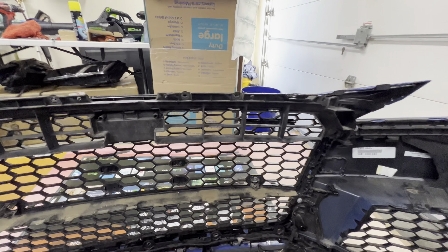The first things I removed were the lower tabs along the bumper. Then I modified the upper piece — you essentially just cut it off, leaving that section. I use the oscillating tool, which makes this very easy. Here's the back of the bumper completed. To recap: cut the bottom half of the top of the grill off, pull the lower part of the grill completely out, trim this section, trim that section. You also have to trim off that tab right there and that tab over there.